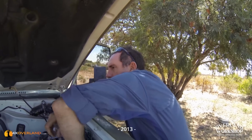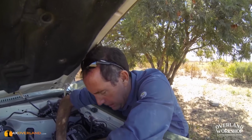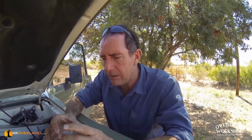Or something that's dirty in the fuel. Normally you just crack this little butterfly at the bottom of the filter and it should run out the hole of the butterfly. The diesel I've got out is actually dribbling out, so I think that the filter might be blocked. I can't see it for contaminants, but for sure I want to change the filter.